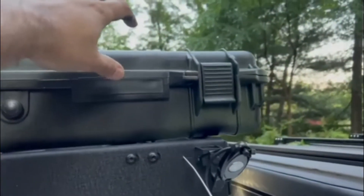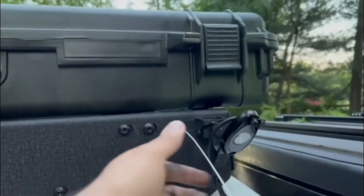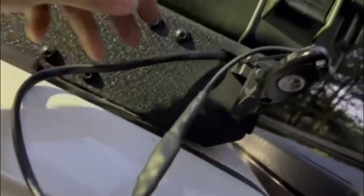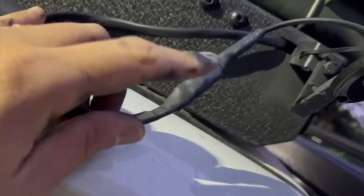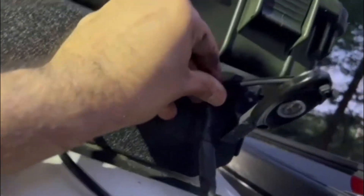I just made the wire harness — at least one side of it. It's on the other side, but because of this case I can't just easily swap it through, so I'm using my handy hanger again to pull the wire through. We're all patched up here — lights in, we did the male into the female connection, and we're all heat shrunk up now. So now I'm going to pull this back that way and get it nice and tight and zip tie the wire.